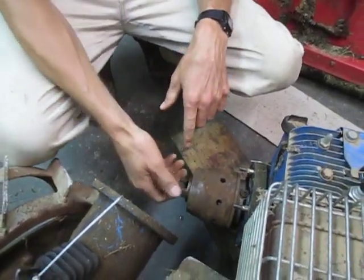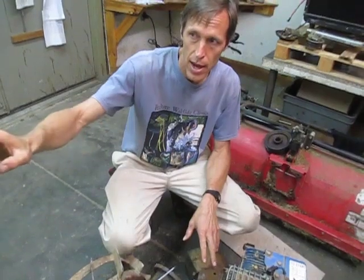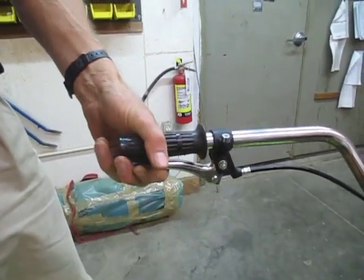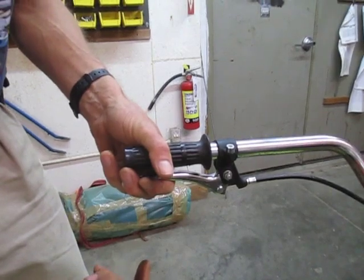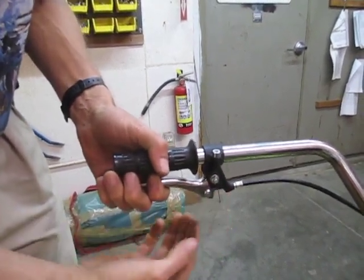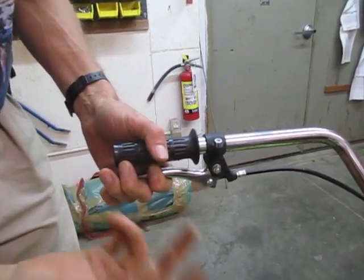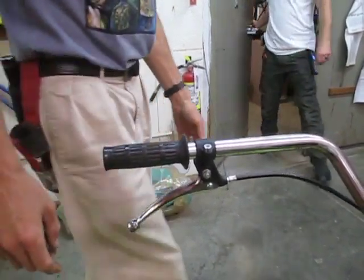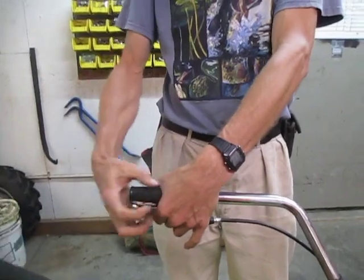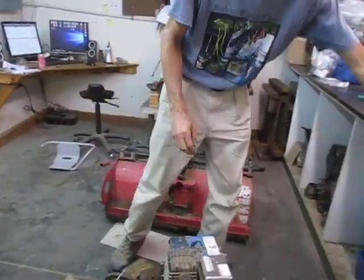This combination was kind of a disaster waiting to happen because when this old transmission was updated to a newer clutch, this clutch handle — designed for the older machine — does not have a way to lock the clutch in the squeezed position. All the newer tractors, starting around 1991–1992, had a little latch where you could squeeze the clutch lever, swing the latch up, and it would keep the lever in the squeezed position, keeping the clutch from freezing. We'll probably give this gentleman a piece of PVC pipe he can slip over here to hold it in the squeezed position.